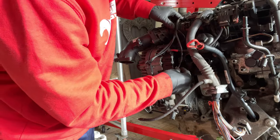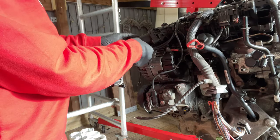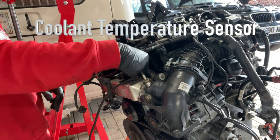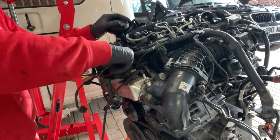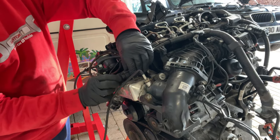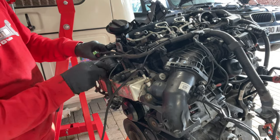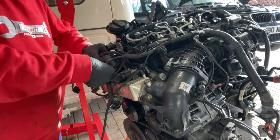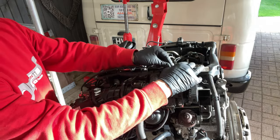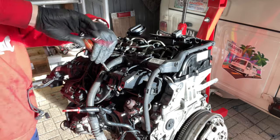Air conditioning — that goes in the back of the alternator, clicking in there, and then clicking into the aircon pump. Looks like it wants to click on there, and then these are going to click into a sensor — it's the cooling temperature sensor. Click that in, that one's in. We've got the EGR vacuum connector there — that one's on. And then the EGR stepper motor going in there; they've all got their little lock clips. A couple of fixings screw into the inlet manifold to hold the looms nicely in place and stop them rattling about.